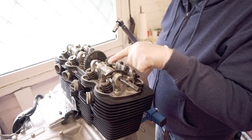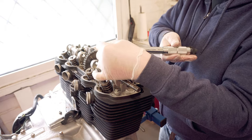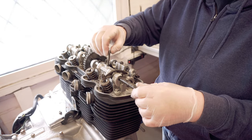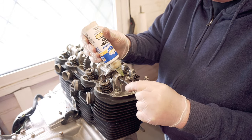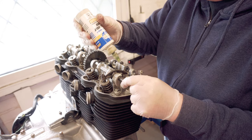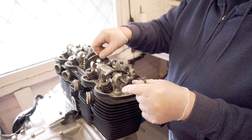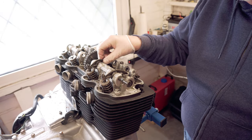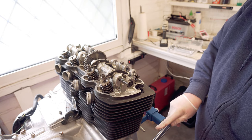Typically, I hadn't spotted that that actually has to run through there, and I wanted them clamped down because of the sealant on here. But now I've got these in as well, I can just whip these off so that I can put it in all the way. Then I hit the next problem, that this cam is actually pushing the rocker up. So I need to turn the engine over a little bit so that I can push it all the way through.